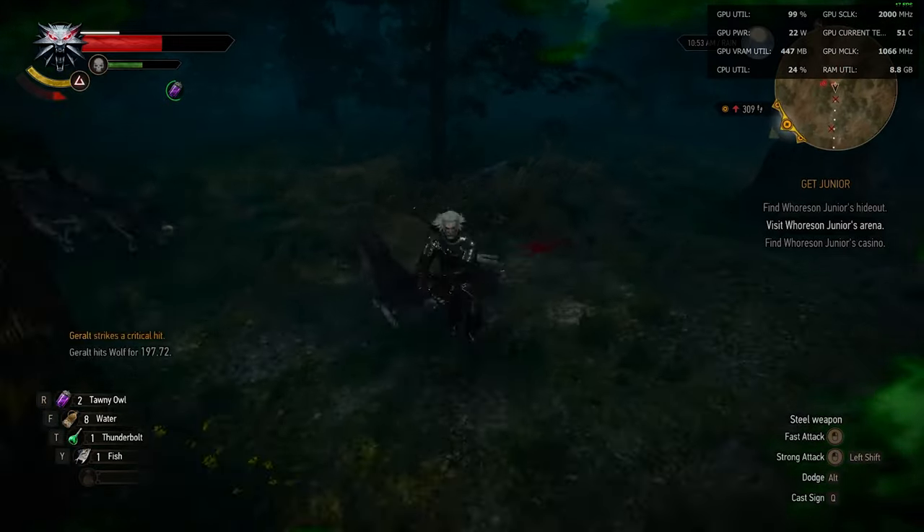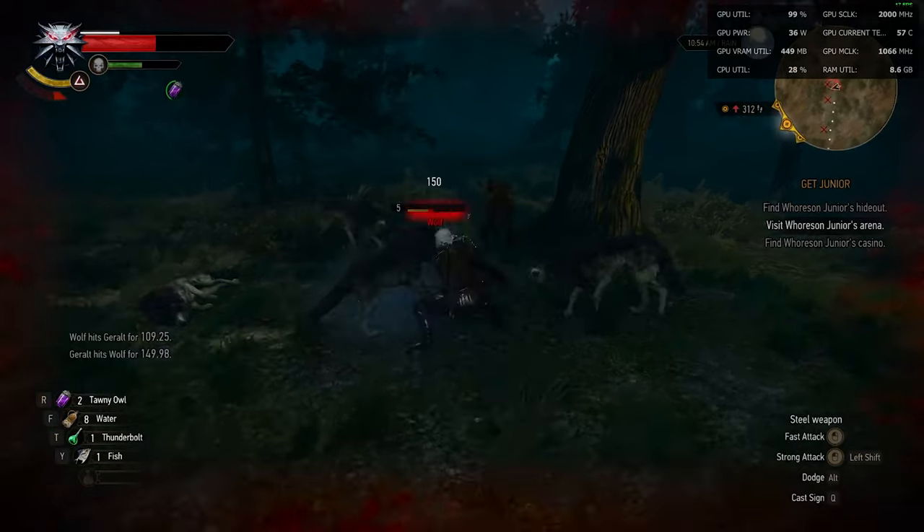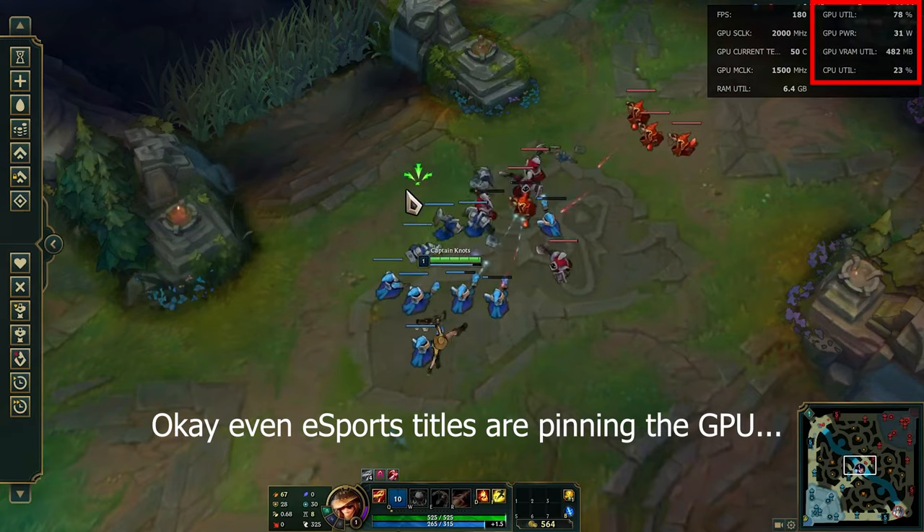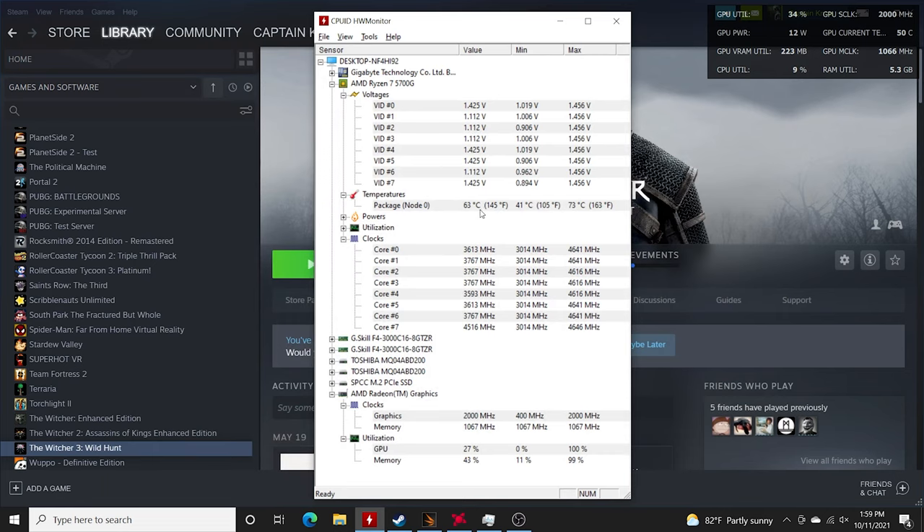Then I stepped over into gaming, and gaming on this is kind of not a good performance indicator. For most gamers, you're probably going to have a dedicated processor and a dedicated graphics card. But in this case, you're not fitting a graphics card in here, so you're relying on integrated graphics. You can play games with decent performance on modern integrated graphics. But the issue is being heavily GPU bound — if you're running a graphically intensive game, your graphics will be maxed at 100% while your processor really isn't doing anything. On the other hand, if you're running CPU-intensive eSports titles, your graphics card probably isn't doing much.